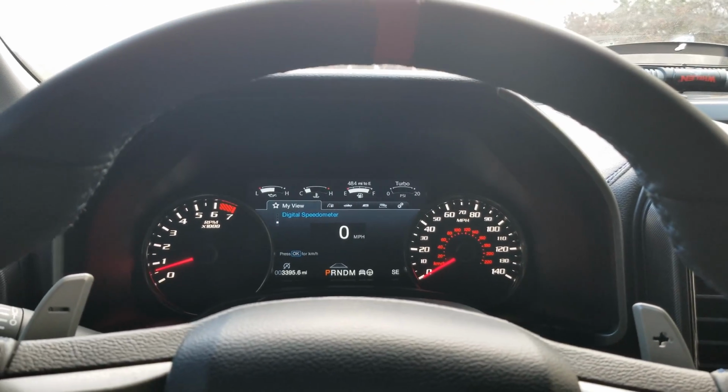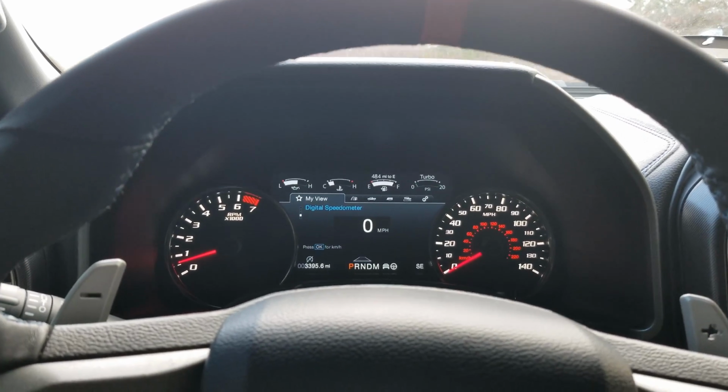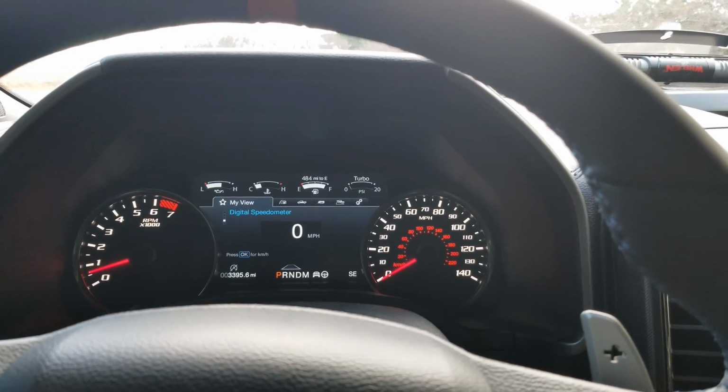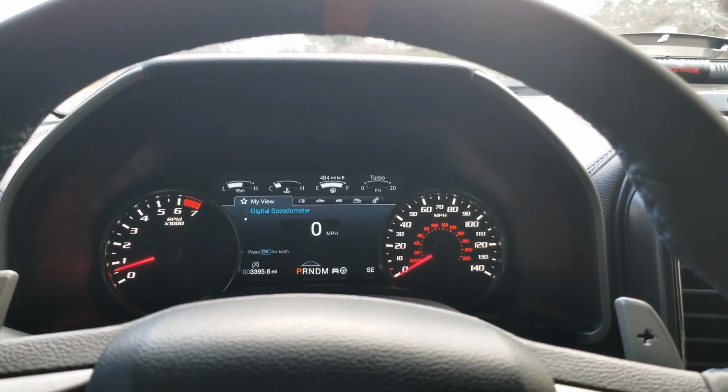You can actually change that setting to be able to adjust to 5 turn signals on the single touch. I forgot to actually hit save on the Forscan option, so mine's still stuck at 3. I'll do that the next time Forscan is hooked up, but for now, just so you know, you can adjust it from 3 to 5 using Forscan.